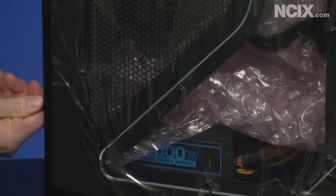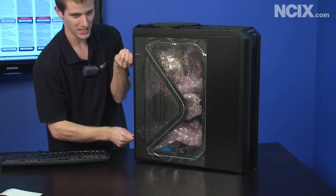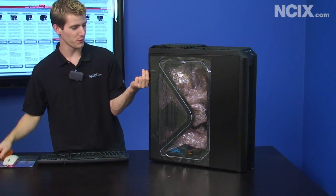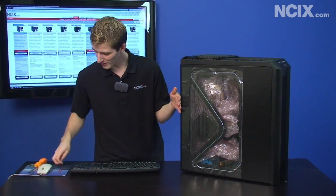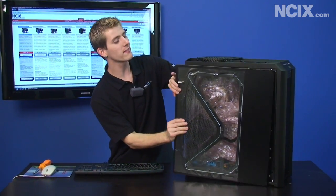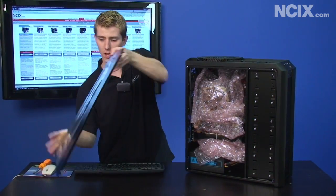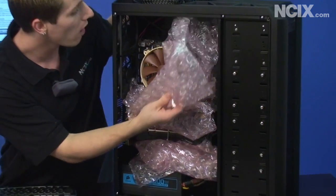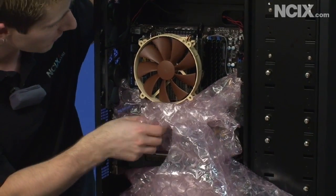You'll see a warning sticker over the power plug on your power supply, indicating that you should read it and follow the instructions before you turn on your new computer. What you need to do is open up the side panel — you'll need a screwdriver to get the screws out of the back panel. Take the side panel off, being careful not to scratch it, and then remove all of the bubble packing from the inside of the computer.